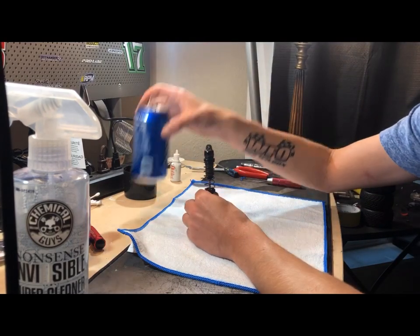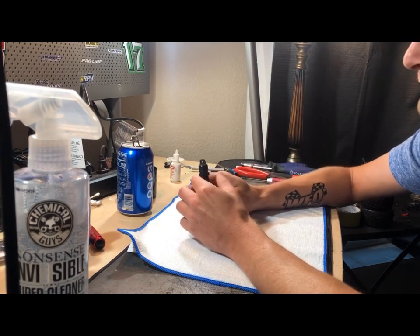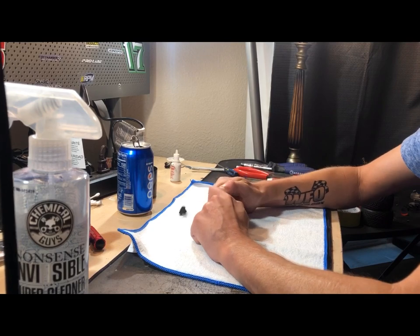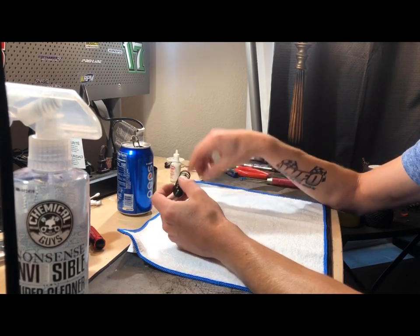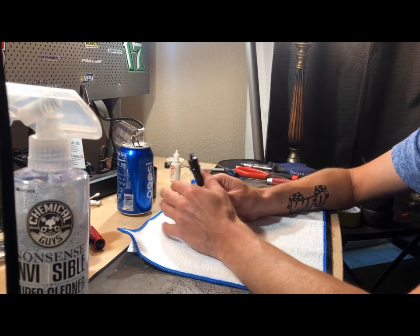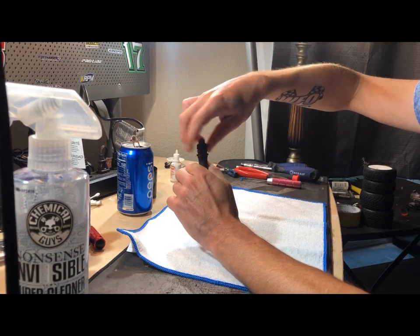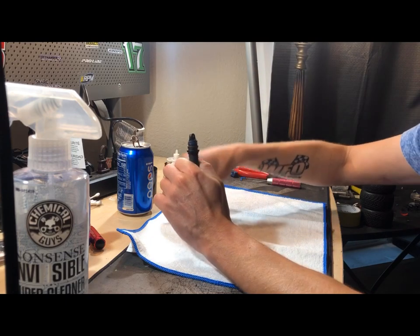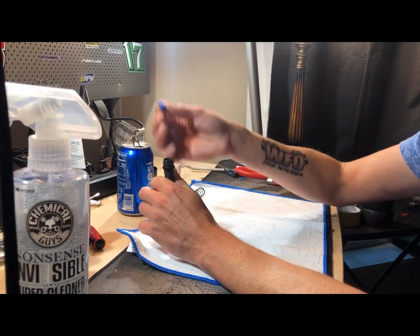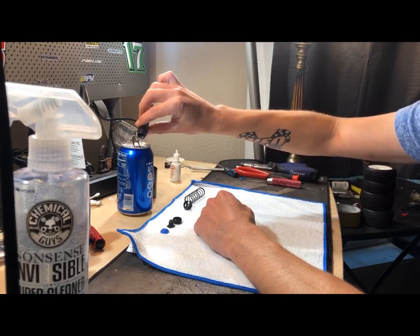Your first step - you need something to drain it in. I drink a lot of soda so I always have soda cans in my office. What you do is - actually, I missed a step. You can do it that way if you can get it off, but go ahead and slide that right collar off the bottom - the holder or whatever people call it. The reason you want to do that is so you can grab the shock body down here, and you just simply unscrew the top cap. Then you have your mounting ring and then the seal - I just call it the seal - and you simply drain out the old oil.